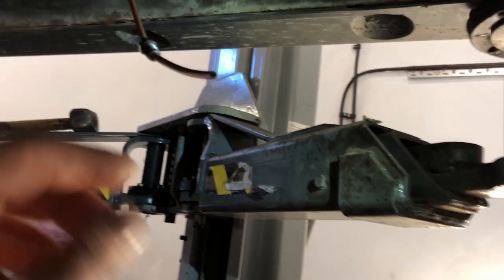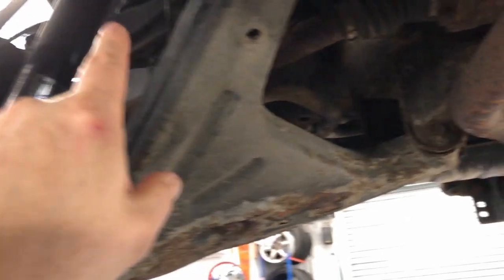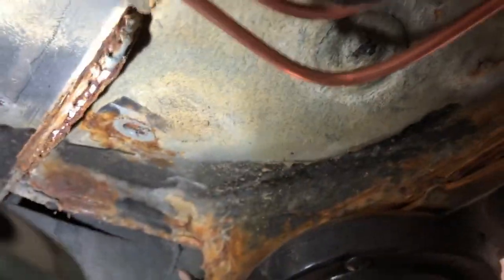I've got the pipe all the way down to here. I've put the original end back on, going to flare this and then thread it up through there and join it back up. I'll work my way back, clip it where it's supposed to go, bend it where it's supposed to go, and clip it all the way along the back where it was originally. Both rears are in now, all tightened up, running down the length of the car, under here, around here, along that, down there — and obviously one splits off to here which I've put the flare on.